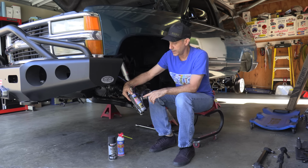There were so many oil leaks. There again, while I was here, the oil lines that go from the radiator to the oil filter adapter housing, it's a tradition on these things, they just leak, and it has been coating the front suspension, and so there were multiple leaks up here. So the power steering was leaking, the oil was leaking out of the oil cooler lines. So I just replaced all of that stuff.